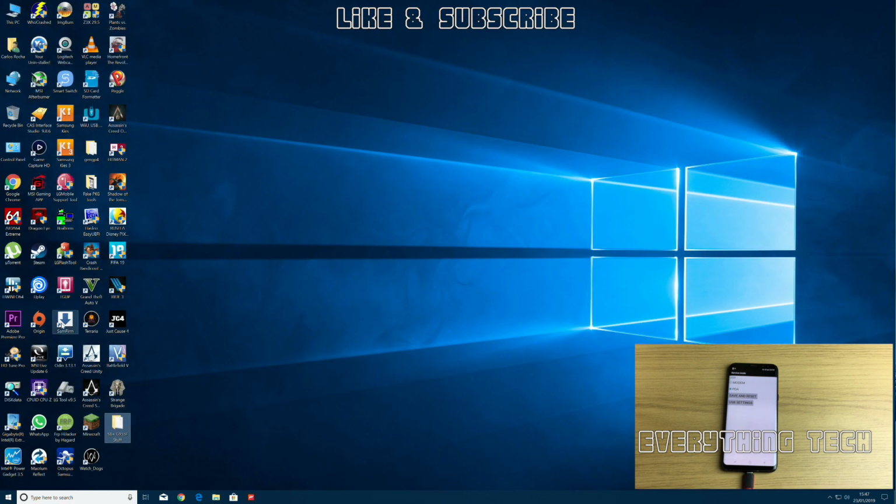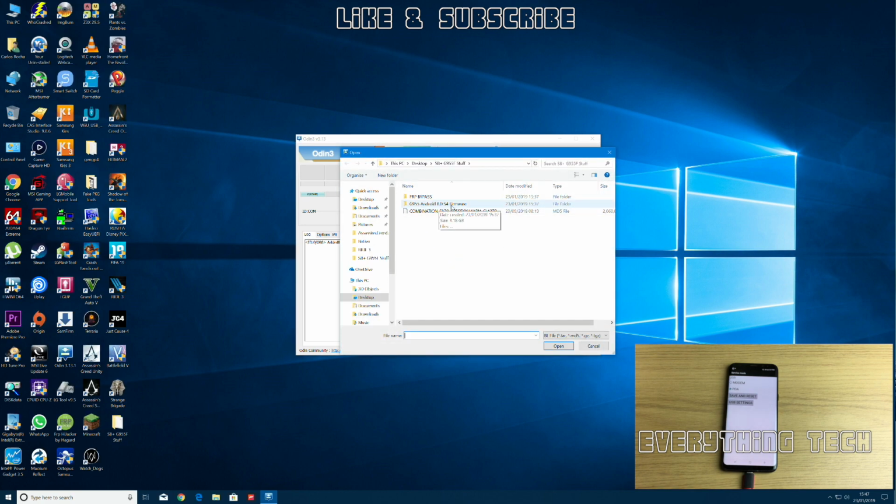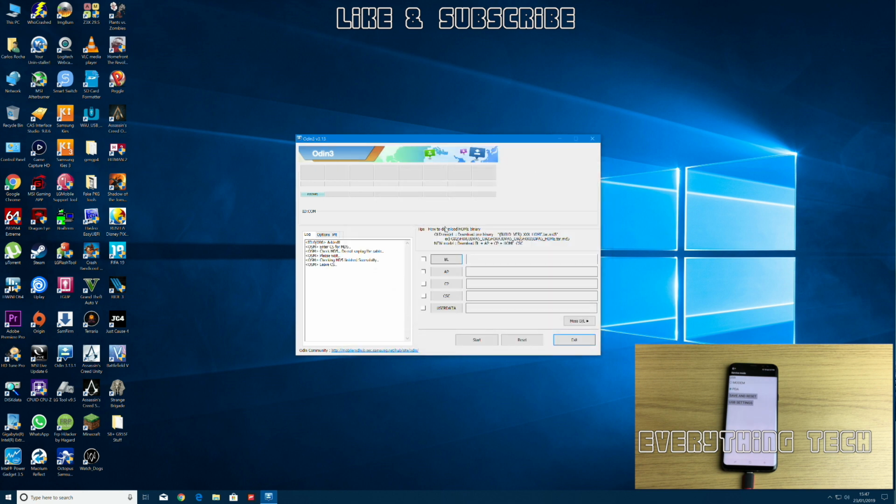When you're happy with it, launch Odin one more time, and now it's time to get our firmware. All the links are in the description, as I said before. So just start by launching BL, which is your bootloader, and then AP.